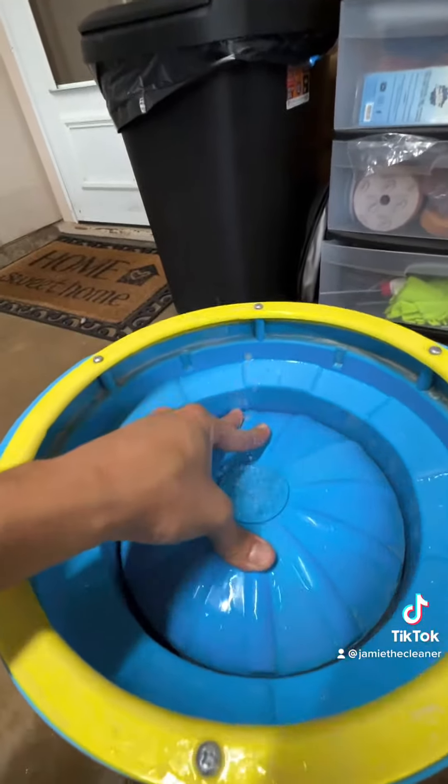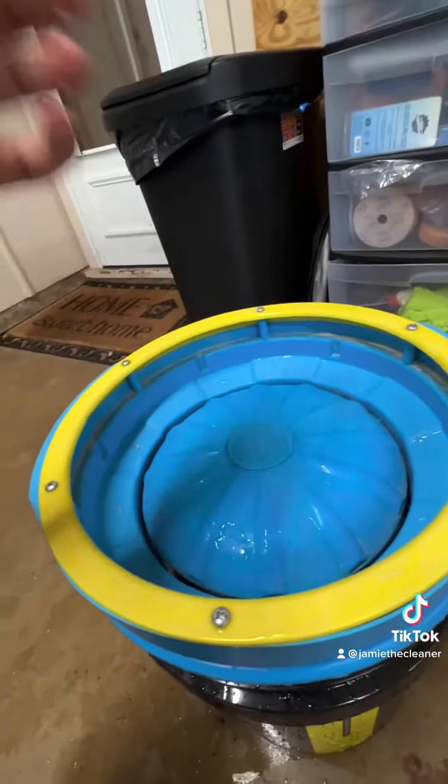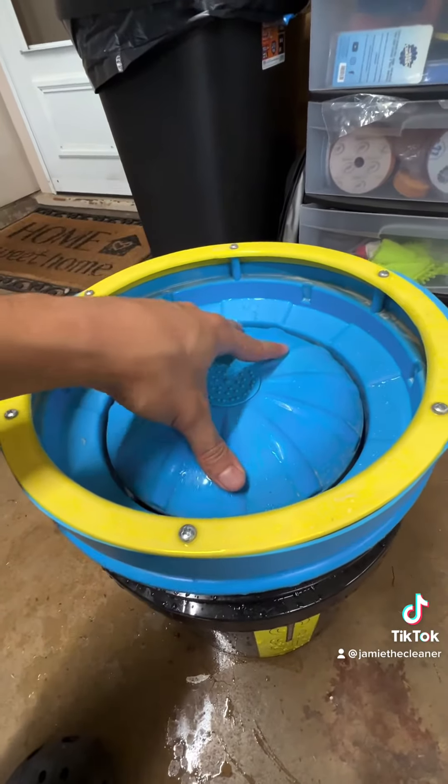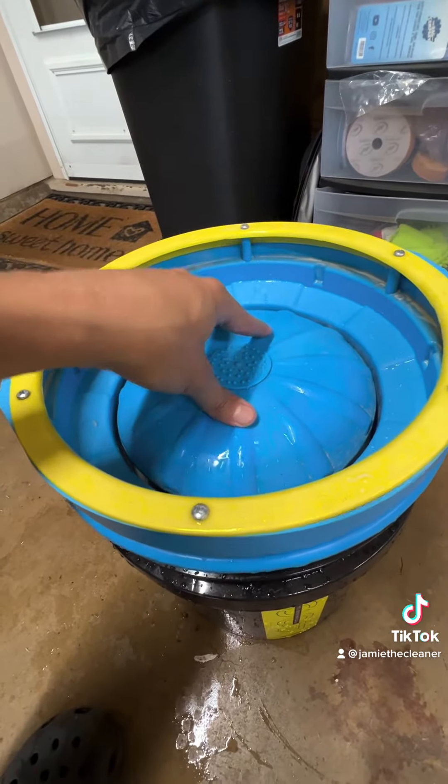As you see here, what it does is pump jets of water into your pad, keeping your pad cool and cleaning it with the agitation right here on a low speed. You can literally get around a vehicle with one pad on a paint enhancement or one-step polish.